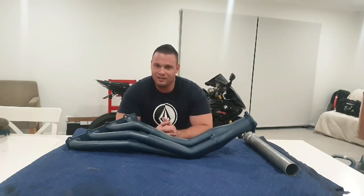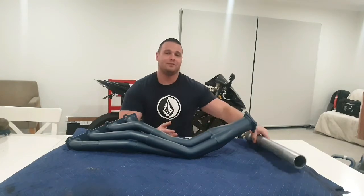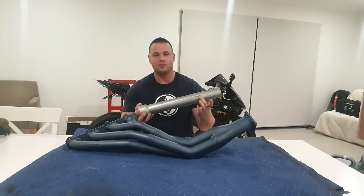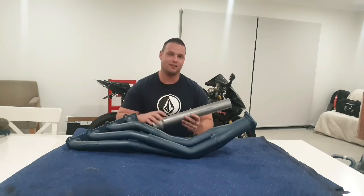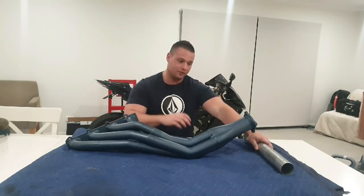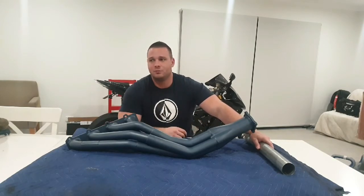Start around 18 inches and you can make it shorter as you go. A lot of guys paint along the side of it and then burn it in — do a run at the strip and you'll see where the paint burns and where it stops burning. Cut it off there and that's considered the ideal length. Whether or not that's true we don't know because every engine's different, but it's a good way to start. Keep reducing the pipe length until you stop going quicker.